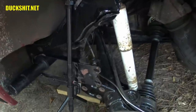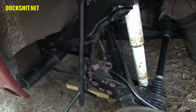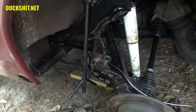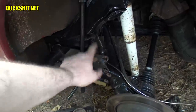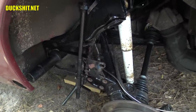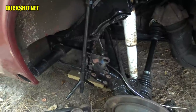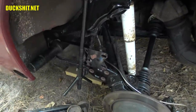What we're going to do is get up underneath that spring plate and, with no preload on it right now, just pull it out of position. We want to move it one spline on the inner torsion bar so that way this spring plate will be down lower, essentially raising the car up. Let's go ahead and make some adjustments and see what we got. First I'm going to put an angle meter on it and calculate approximately how much angle changed and convert that to inches of ride height raise.